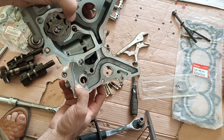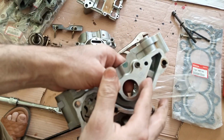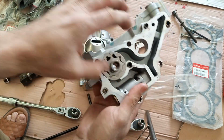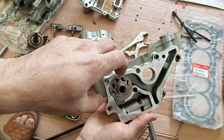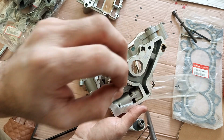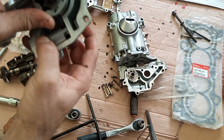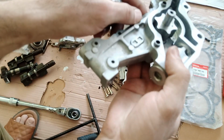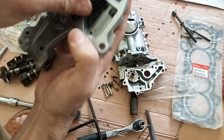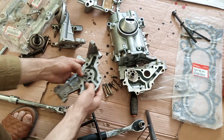My suspicion was right. This oil pump pumps so much oil. Honda limited it here, because Honda knew the potential of this pump, since it is spinning so much faster. The oil retaining unit is also bigger and has more teeth to it. We will see next. So they limited the oil pressure. Look at that, all that hindrance. In this one you see there is some type of hindrance here, but it is not equal to the K24 one. Let's measure the inner wheel, to see if the K24 one is bigger or not.